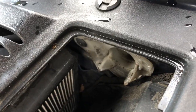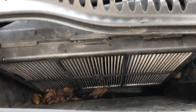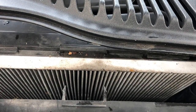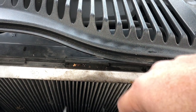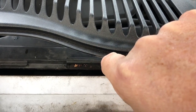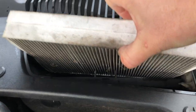Just to give you a quick view of where it goes — it pushes in right there. So all we need to do now is literally just flick the front of the frame open by pulling on it, and the filter itself can just be pulled back. Once it's out of its holder you just pull up gently, manoeuvring it to get it out of the hole.